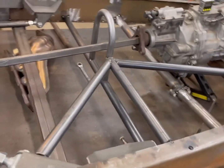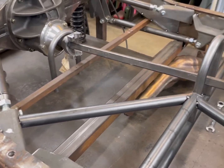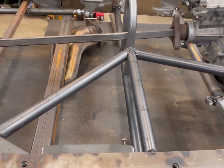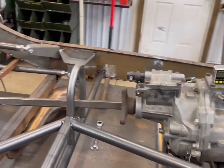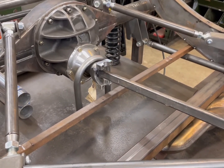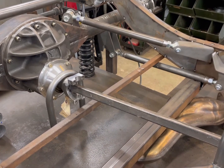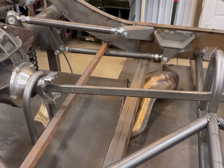I've moved on to building some kind of X-member here to strengthen everything up. Just a precursor — I'm not a chassis guy, so I'm just doing what I feel is best. The car is going to get some kind of cage, which will help tighten everything up. I wanted to go with inch-and-five-eighths tubing, but I just don't have room for intercoolers and exhaust, so I'm going with inch-and-a-quarter to save space, and hoping the cage will tighten everything up. I've also got a back driveshaft loop going in. I don't believe I need it to race, but if something in the driveshaft comes apart, you've got two hoops in there that protect you.